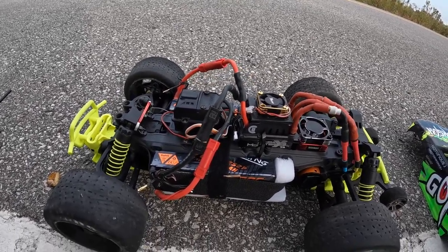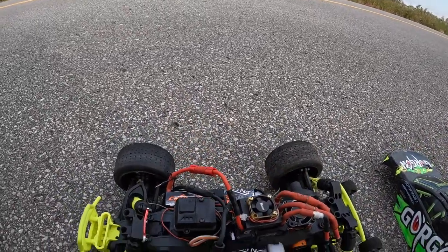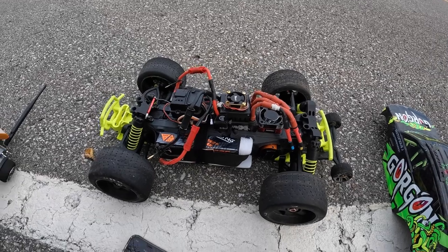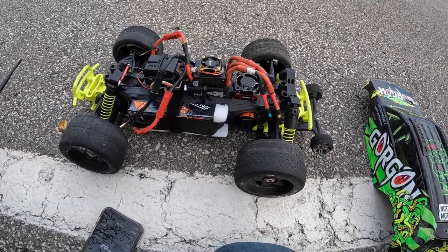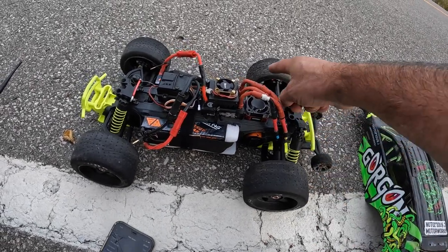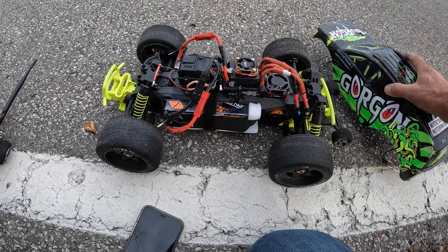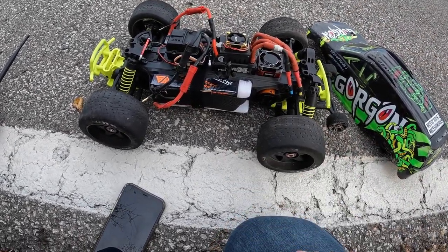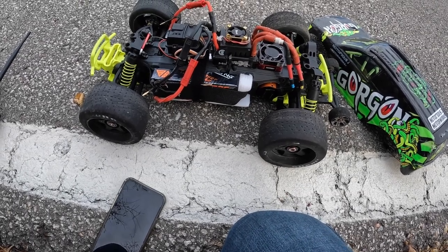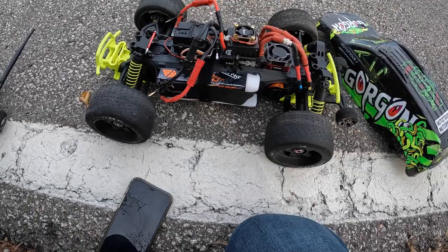Running as hard as I am — 70 miles an hour today. I don't know if we're gonna have to maybe gear it down or power it up — a couple of different things we can try. Right now that's a 26-tooth pinion, 50-tooth spur. Anyway, that's the Armageddon 4S, 3800KV — 70 miles an hour today. Top speed so far for this car is 76. Anyway, I'm out.